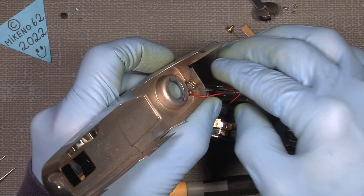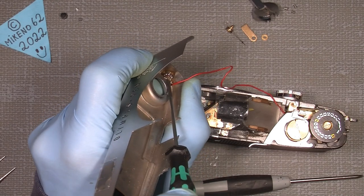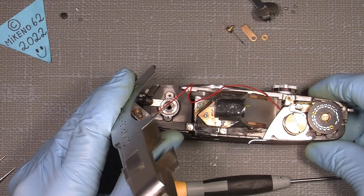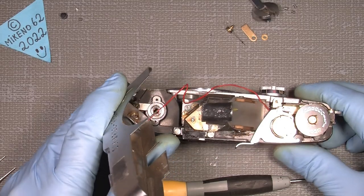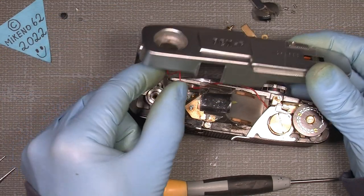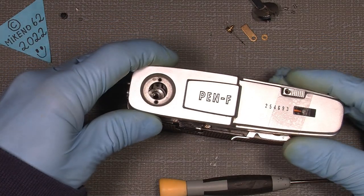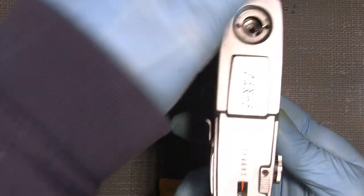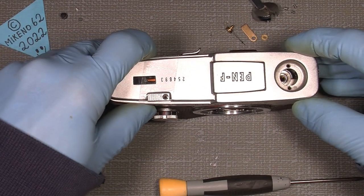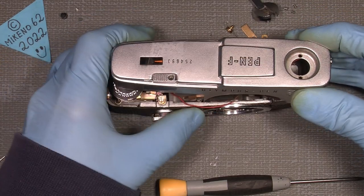So I think maybe I will do this with a piece of tape — then add the shutter button itself in here. Come on little fellow. Of course it should sit like this. But you see, because when I turn the top cover over and get this into place, this will fall out. So I think it's a good thing to have a piece of tape put on the side of it. See — it will stay, so that's good. So now in a more relaxed way I can put the top cover on. You see the wire here — it has to go on this side, not over here, because it will get in trouble with this part here. The sync socket will interfere with this. So that's why it has to stay on this side. With a little longer screwdriver I hopefully can manage to screw it into place.